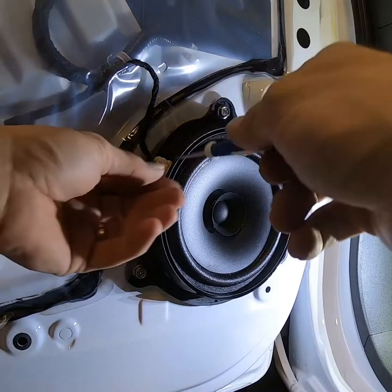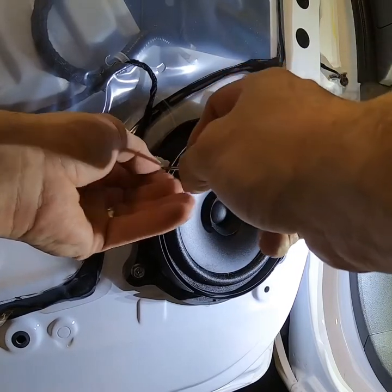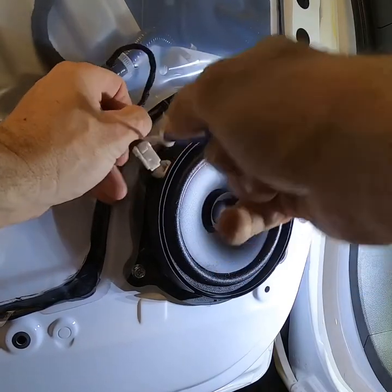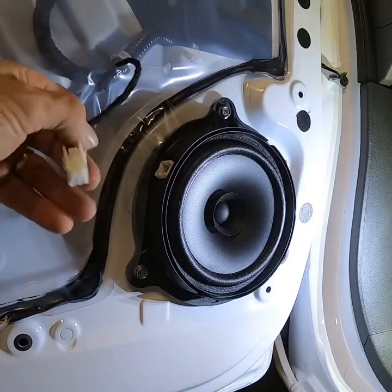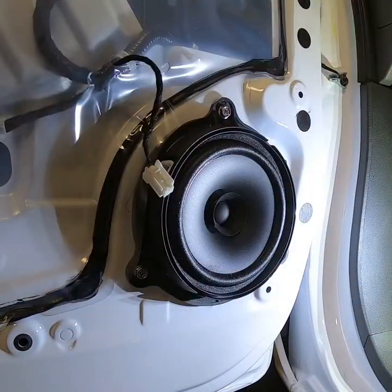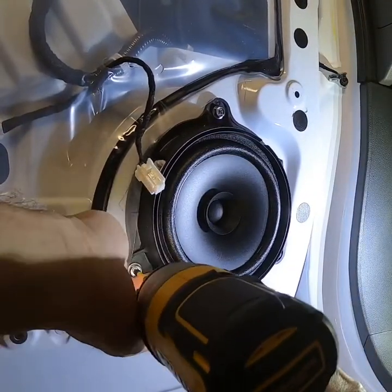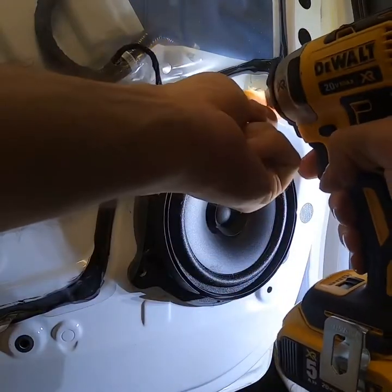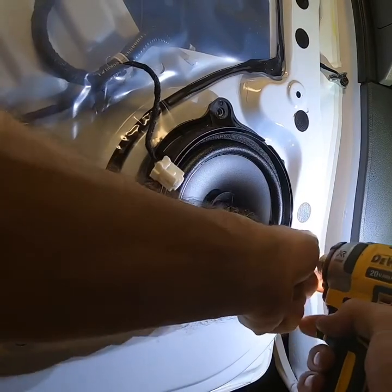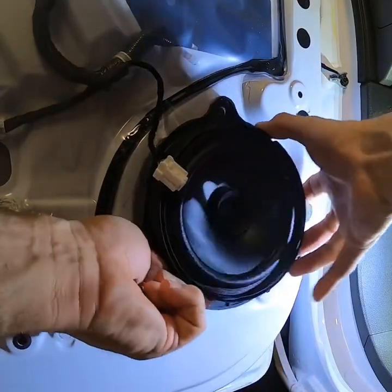I want to move my wiring harness. I'll lift up on this little tab and push straight in on it — pushing in, pull straight up on the harness and the wiring harness comes off. The next thing is taking the three bolts out — 10 millimeter, or use your impact depending on what you feel like. I'll push a little pressure on those so they don't strip out. Those are loose and the speaker pops out.